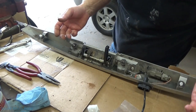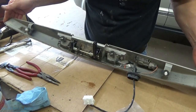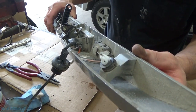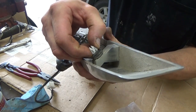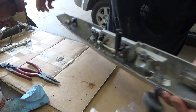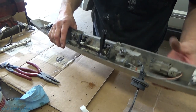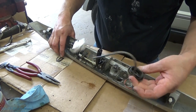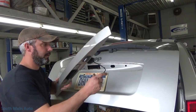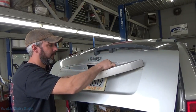So we'll put it back in. Before we do that — because I didn't show taking this apart, since I didn't anticipate doing a video — if you're taking this out, you have to pull the tailgate panel off, which we'll put back on. Just a couple screws and two bolts here, but the tricky part is these white clips right here. You have to reach into the tailgate and pinch these and push them out at the same time — they've got locks on the top and bottom and they're quite stout. Took about all I had in my little meat nuggets to squeeze them and push them through. And then just the one wiring harness that goes through the gate. We'll push the harness back through, and that harness actually clicks in — like so.